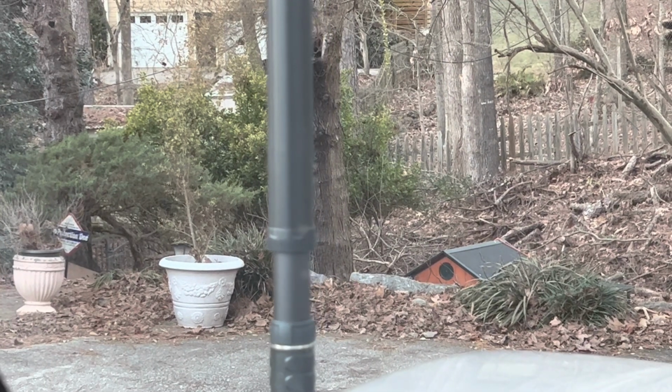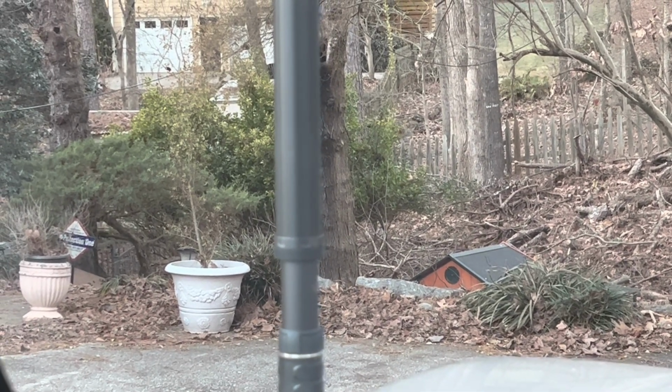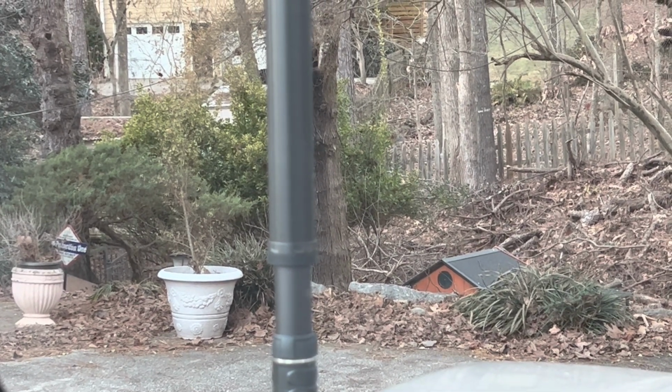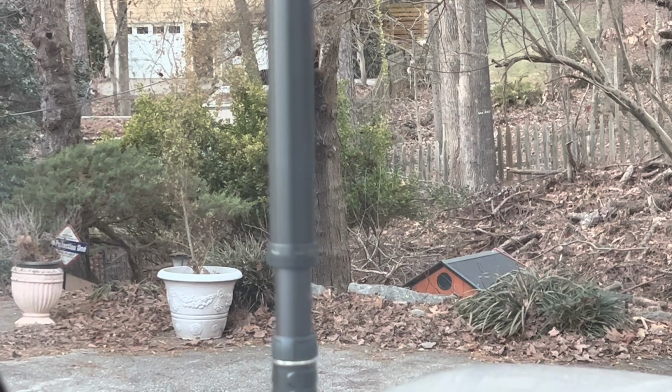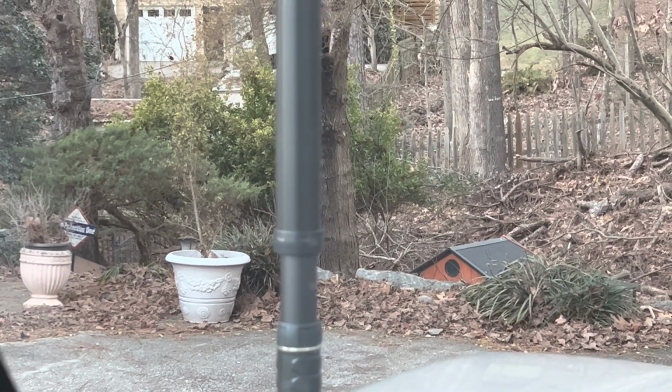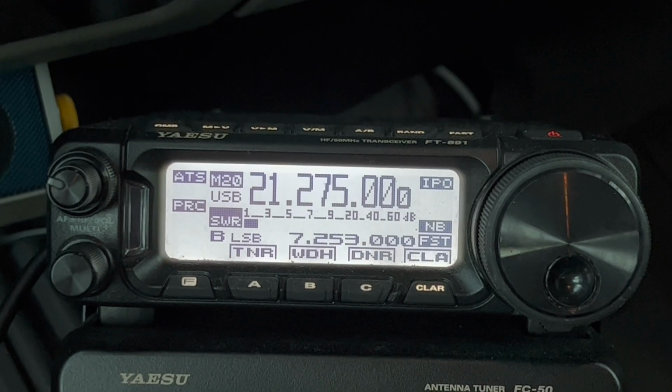You know, it's nice when you get up here to these short wavelength bands compared to 40 meters. You know, and 40 is the lowest band the antenna can function on. It won't go any lower than 7 megahertz operation. So, but you know, it's a good mobile antenna. So now I don't know that it's going to beat a ham stick.